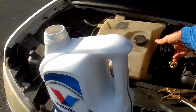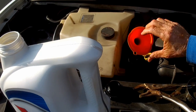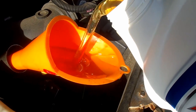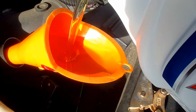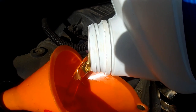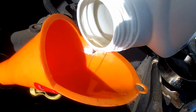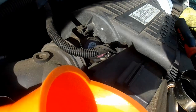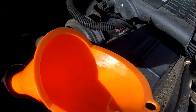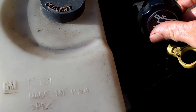Let's add the new oil. We're going to pull off the oil cap, grab our handy-dandy small funnel here — should work just fine, just have to pour it slowly. We're pouring in our five quarts first, letting it go slow as it fills up the funnel pretty quick. Finishing up those five quarts, then we're going to add one more quart of 5W20. It's summertime and it's hot — we need a thinner oil but not too thin, so I like the 20 weight.